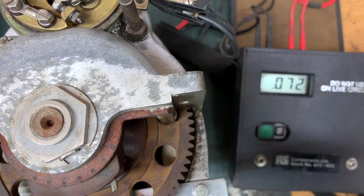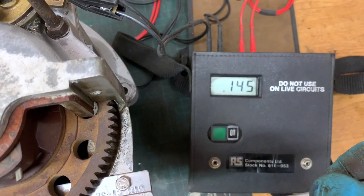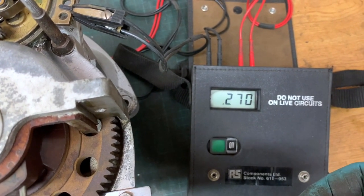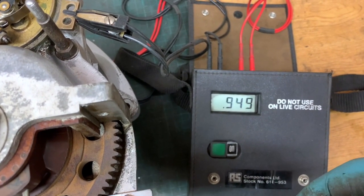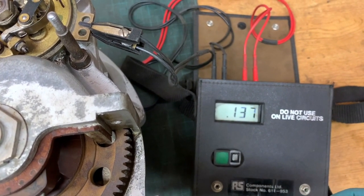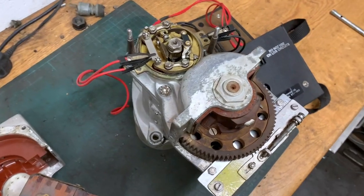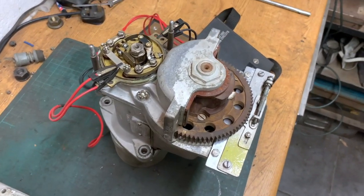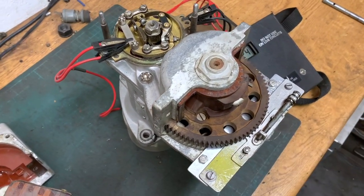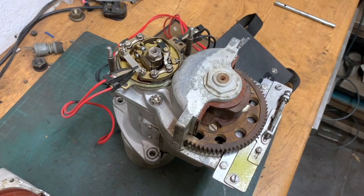I've got it there. I'm turning it with this bolt here — see how sensitive all this equipment is. The points are literally just on the point of opening there. So that magneto is now set in the position where we can fit it to the engine. It's not quite as simple as just dropping a shaft in like it was on the cams — you actually have to hold the coupling, as you'll see in a minute. So having this locking device on here, this homemade tool, makes it a lot easier to not have to hold that rotor arm in position. We'll go and fit it to the engine now.